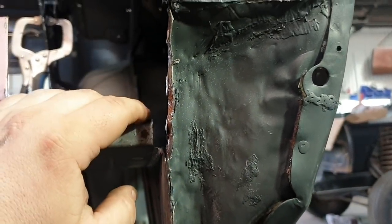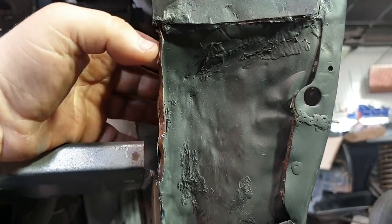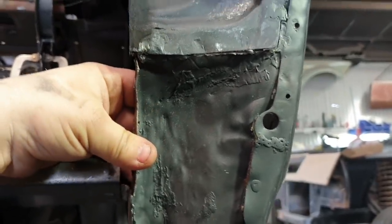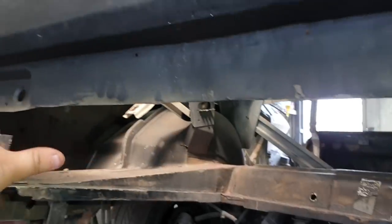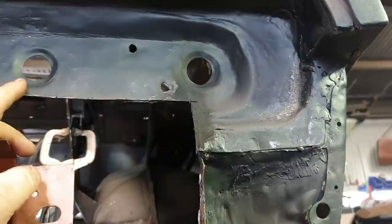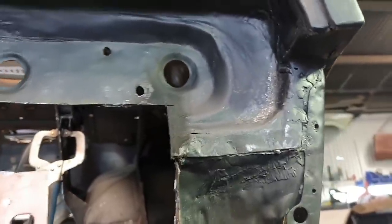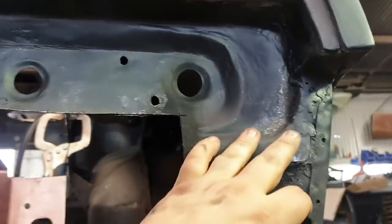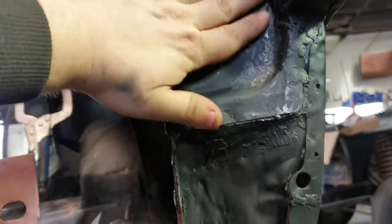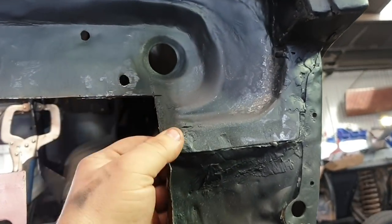I was just studying photos that one of my loyal fans sent me of an original Landau that was super unmolested. I was trying to get an idea of what this is supposed to look like, because all of them have been repaired these days, and finding photos of an original one is near impossible. So studying those quite thoroughly, I spent a bit of time hammering the style line back in through here and recessing that tower light, because that was all crushed out.